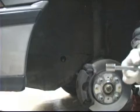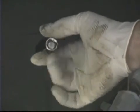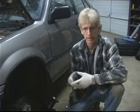It's a 17 millimeter bolt head on there, and I'll just show you by basically sliding it in. It's located about 3 inches behind that access panel there, and this will give us the ability to rotate the engine over while we're adjusting the valves. So please watch our next segment. We'll cover finding top dead center and prepping the vehicle.